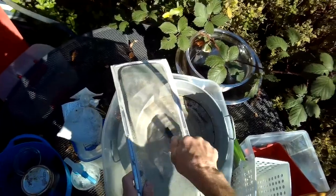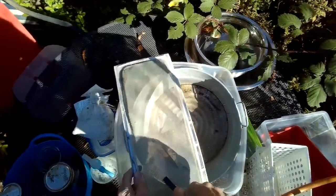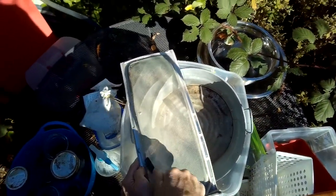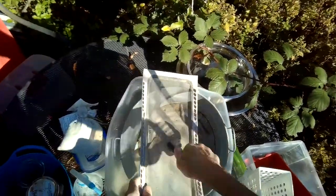I think it's still okay to use the dryer lint sheets, or dryer anti-static sheets, but you just have to be willing to clean it probably once a month so you don't get that thermal fuse blowing. If thermal fuse blows, unfortunately, you can't reset it, so you just have to replace it.